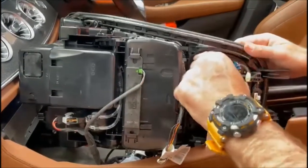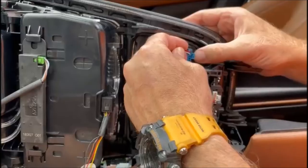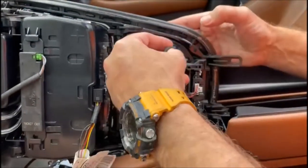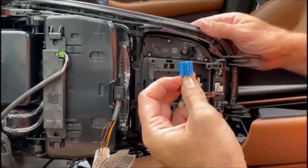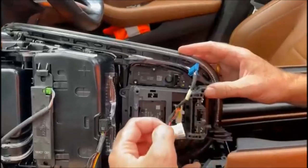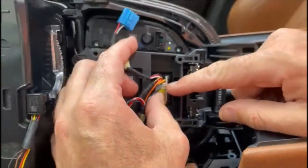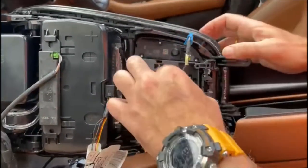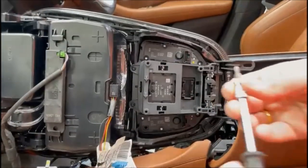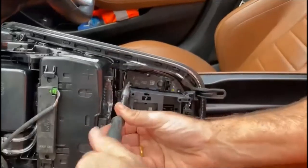The part we're looking at today is this central control panel. These clips just come out by pushing in the little tang like that. If you haven't got enough fingernail, you can just put a screwdriver in there and do the same thing. They just come out — one, two, three. Then this one here is one of those press-it-in-and-self-release type clips, and it just pops out. Then you've got this control module, and four screws — all T20.